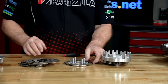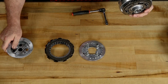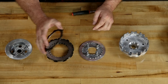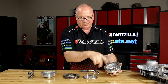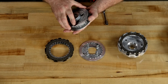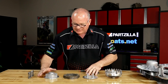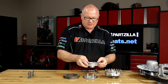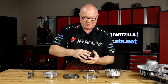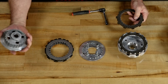Now that I've got it pulled apart in an exploded view, let's talk about how we're transferring energy. This is basically your input with the driven gear, and this is the output right here. Each one of these fiber discs is actually locked into your clutch basket, so they're sitting there spinning. Each one of your metal discs is actually locked into what they call the clutch boss, so they're constantly spinning. When you disengage the clutch, it pushes these springs in, lifts this plate to where these metal plates are no longer making direct contact — enough that they can slip and rotate without engaging. That is how it transfers energy from this hub to the output.